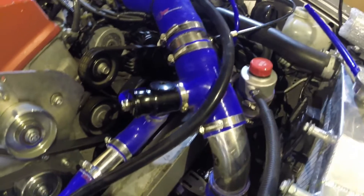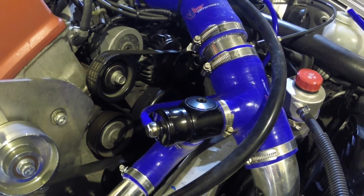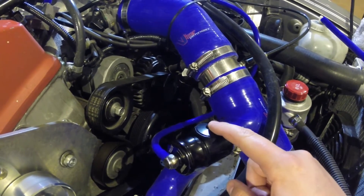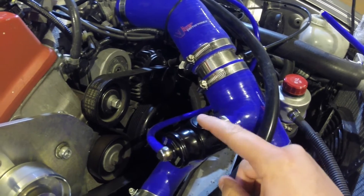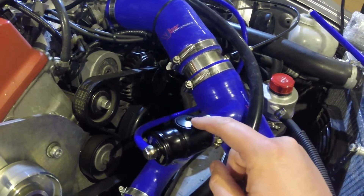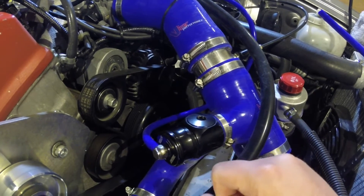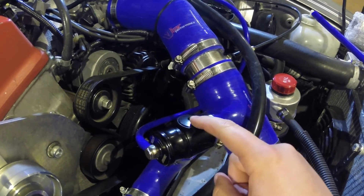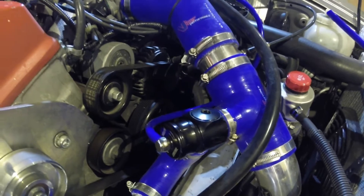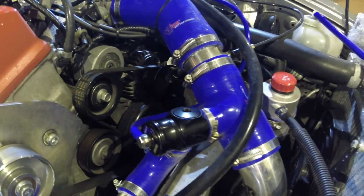This is the 34mm version, which I bought for £160. It's dual port - the idea of the dual port is that you have a secondary direct-to-atmosphere vent on this side. The problem for me is that it's so noisy. If you're using this like that, the supercharger is always bypassing, always dumping air out of here, and it's just a loud whistling noise. It's not a good noise - it suggests that you've got a boost hose that's blown off. So I decided to block that up.